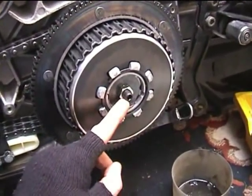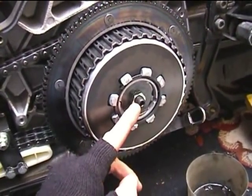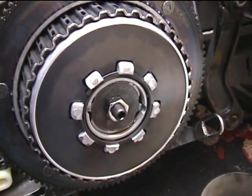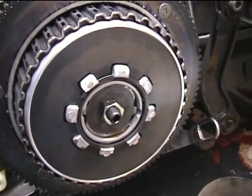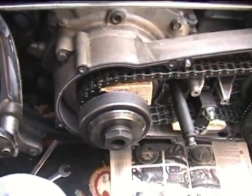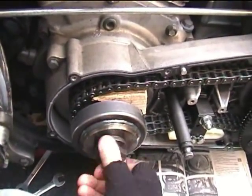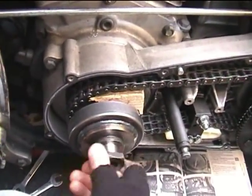I've just measured this — just in case it's something to do with the minus 7.5mm — it's something to do with the clutch adjustment. I got a decent pair of circlip plier removers and the circlip came straight out without having to gouge at it, which was really good. A decent set of those circlip pliers — you can get about four all doing different things — they're worth it and I've used them again and again. So now I'm going to attempt to remove this and just keep things in the same position. I've got a phone camera and I've already photographed this, so if there are any problems I can have a look.